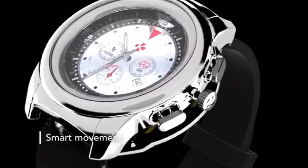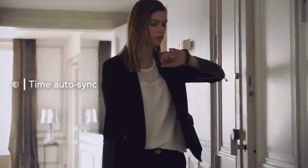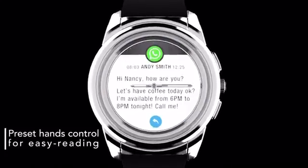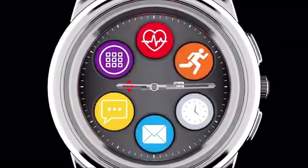Why use a traditional quartz movement when we live in a brand new smart world? We worked jointly with several partners to create what we call the smart movement. Built around two micromotors, this movement is capable of not only providing accurate time, but more importantly it can be controlled by the watch CPU to automatically adjust time depending on the time zone where you are, and also move the hands to where we need them to be on a particular screen. As a result, no fear of having hands covering text on your emails or messages — we can position them the way we want to deliver the best reading experience, and they will return to their original position automatically.